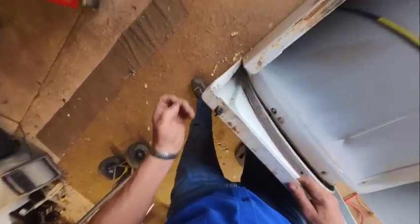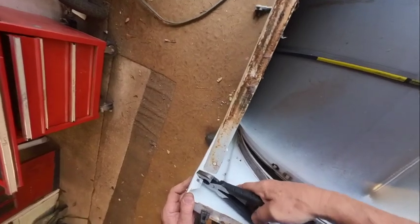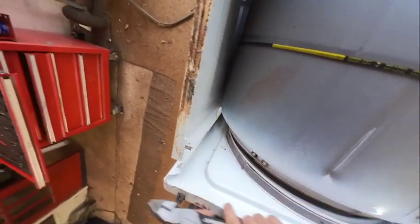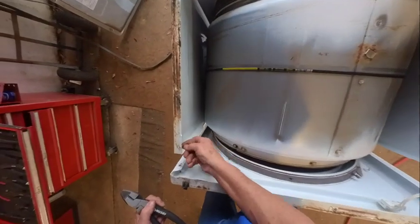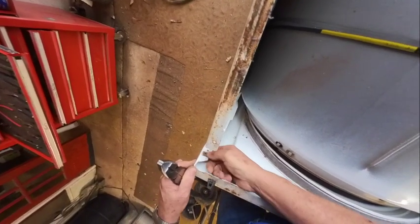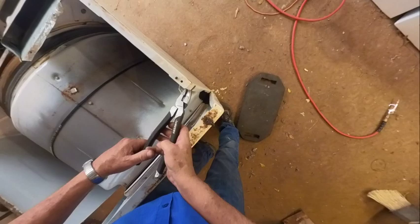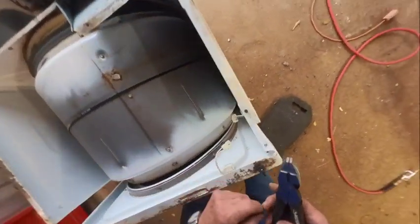At this point I found out why they used those long deck screws. When they put it back together, there are two clips that slide over the metal — they fit over two 5/16th inch screw heads. They had put the clips on the wrong surface — on the cabinet surface instead of the front cover surface. So I swapped those over to where they're supposed to be, and it eliminated the need for those long screws. The second clip was a little harder to get off, but a little hammering got it to come off and I put it in the right position.